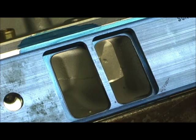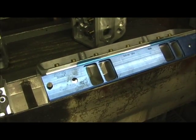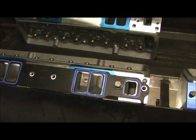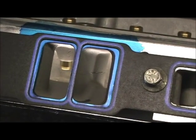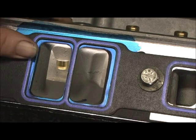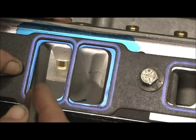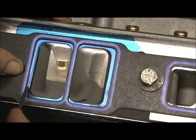Let me show you over here — here's a head I put beside it, bolting on a 1206 Felpro gasket. You have to be a little bit creative with your silicone and moving it around. What I tell people is to take the 1206 gasket and trim the black down to where it touches the blue, using a Dremel tool.